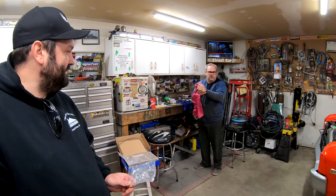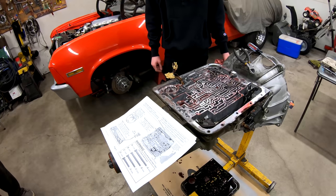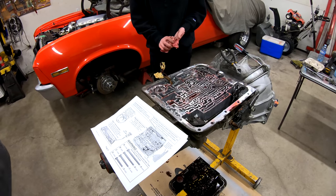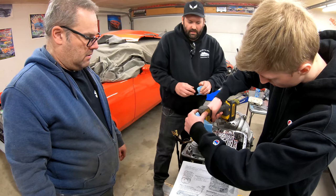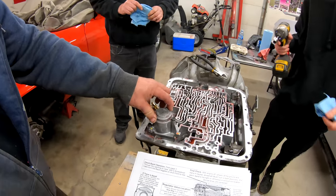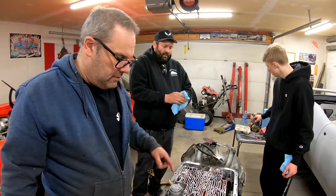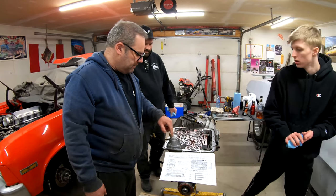I knew that was going to happen. I was going to say, let's move the transmission closer to the bench because it's going to shoot transmission fluid all over probably. Don't overtighten them. The shitty thing with the transmission is it's aluminum, so all these threads — torque them too much and you're going to rip the threads out.